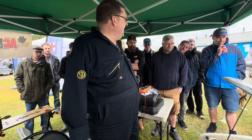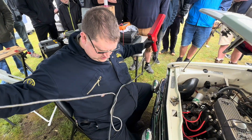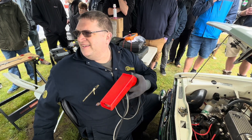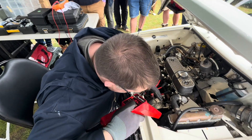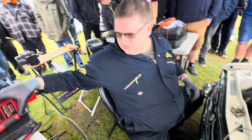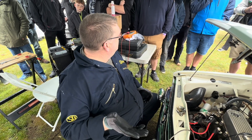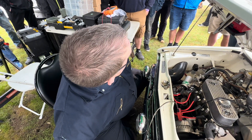Shall we start looking at timing? Let's now have a look at what's going on. How many of you have got timing lights? How many of you have got cheap timing lights? How many of you hate timing lights that flick and flitter all over the place? Cheap timing lights. Next problem: I can't see a timing line. If you want to set an engine up, you need to see the timing marks. You've got no hope of getting an engine right if you can't see the timing marks. There have been many cars this weekend where I can't see the timing marks. Let's turn it off and highlight the marks.